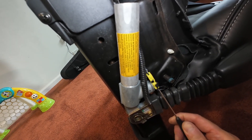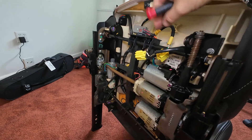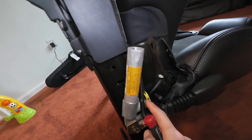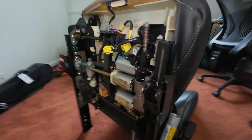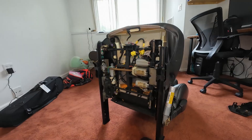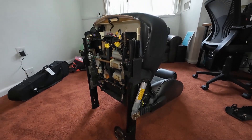There's the safety clip — that's how you remove this. We see a black and a white wire. This harness connector with the black and white wire is where we saw the 20-megaohm reading, so we're on the right track — it leads to the pretensioner. Disconnect this harness connector and follow the loom to the pretensioner. Disconnect it, swap in the replacement — which I already purchased for around 85 bucks used online.